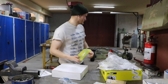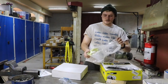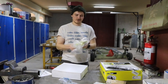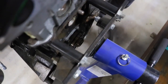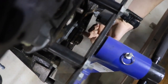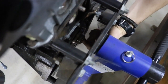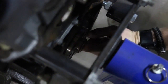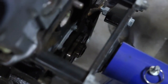We're going to do the swap probably next month over a couple of days, as we don't have that much space in here and vehicles keep coming in and out. So we move over to the RB engine - this is not a Land Rover engine but it has completely the same concept. We've got this plate right here which is what we want to replace on the TD5. You undo all the screws and pull it out. This is the rear of the crank where the spigot bearing sits right in here. The gearbox then goes into this bit. If this seal starts leaking oil you have to take everything apart just to change it, so that's why we change it now while we have everything apart.